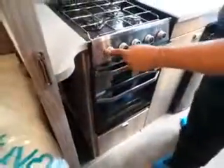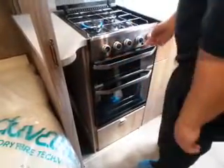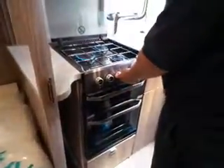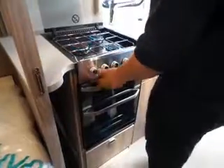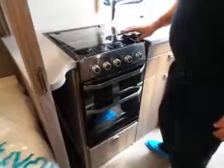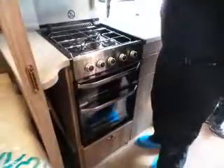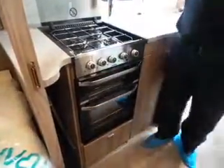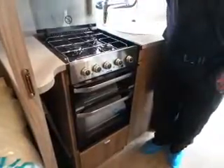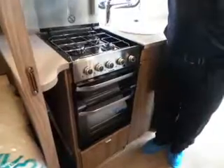The hobs are as easy as one, two, three — simply hold the knob down and the igniter lights it. There isn't a shut-off on the cover, so if you pull it down while the hobs are on they do stay lit — so obviously keep kids away when it's on. Also, if you've been cooking for any length of time the hob area will get hot, so always let it cool down before you drop the glass cover back down, otherwise you'll shatter the glass.